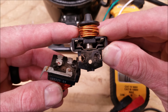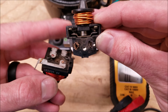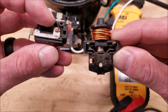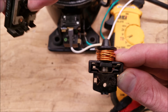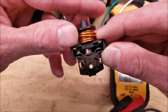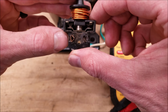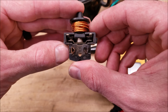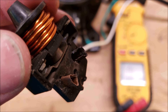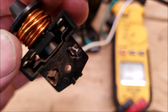There are two different versions of these relays. One has the coil up top and one has the coil down low — it depends on the model and manufacturer. With the coil up, the contacts between start and run are open. With the coil down on this one, it is also normally open, because if I flip it over, the contact on the bottom connects when flipped this way. Each compressor is different regarding where the taps for common, start, and run are located, so be aware of which relay you're working with. Here is the inside of a current starting relay with the coil up top — you can see that this connection is actually burnt, so it's no longer going to be connecting to the compressor terminal.